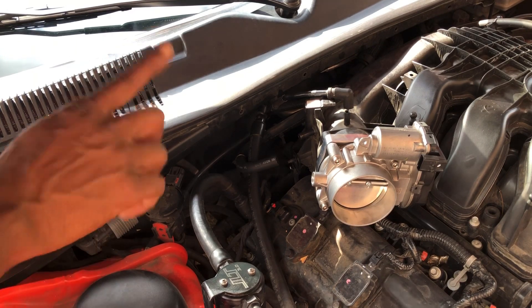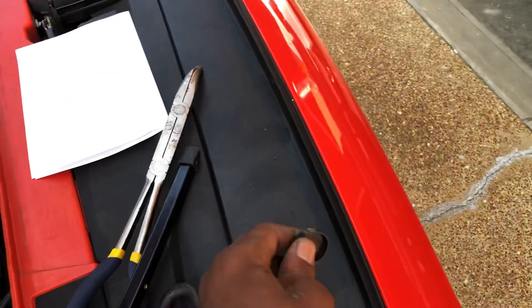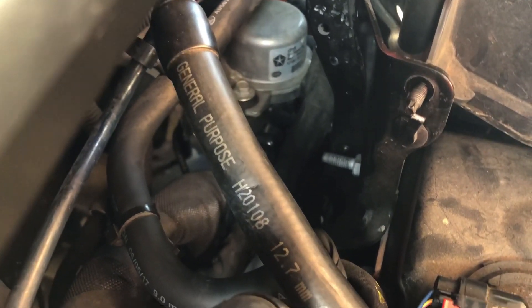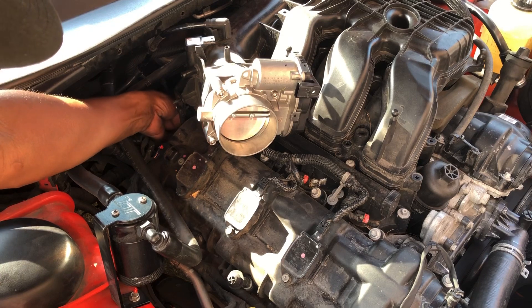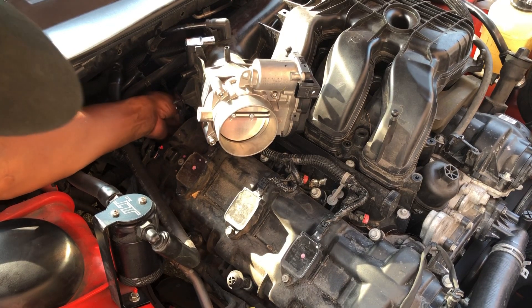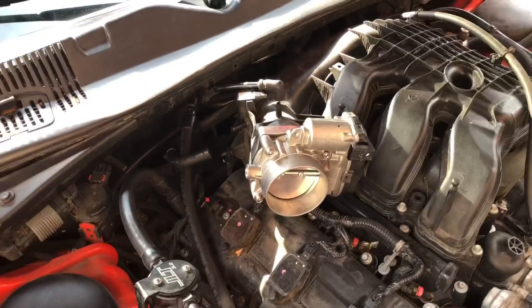That one should look like this — got them four bolts here, two back there and one on the other side. I thought there was another bolt back here but I couldn't see it because it had this piece on it. I was holding the wire right there so I couldn't even see it. But I spotted it in the directions — there it is, that little bolt right there. Got it out and the bracket came loose. It actually came loose easily, and I can set the whole washer back there. Now that I got this bracket out, I've got my 8-millimeter socket wrench.